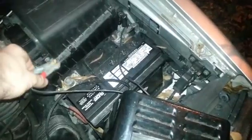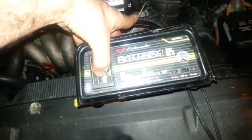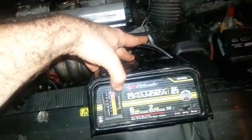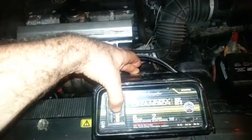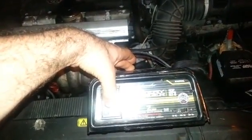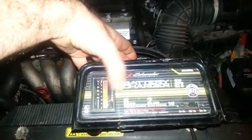Let me show you where that battery's at after charging most of the day. You don't want the charger on unless you're actually charging. Like I said, typically when I leave it on two amps and it draws down closer and closer — when you have it set to six amps, how much the charger is receiving is important, or how much the battery is taking. The lower this gets, the closer that battery is to being nicely charged up. It's about done — it was sitting close to two amps just before I messed with it, and now it's below an amp that the battery is actually taking.